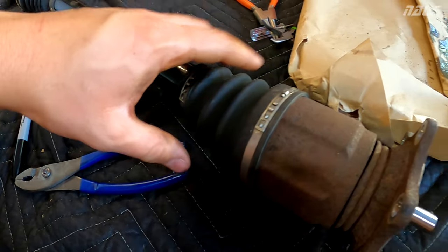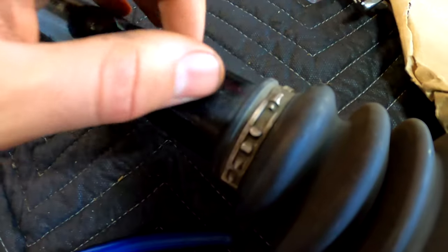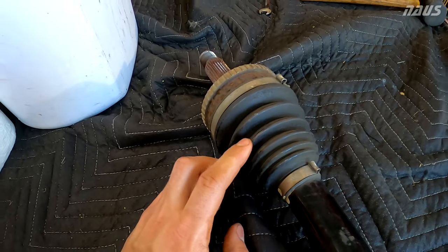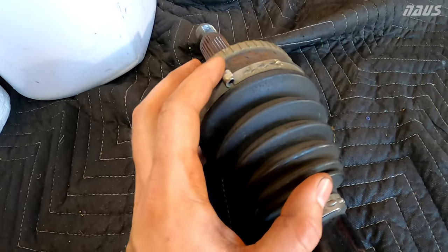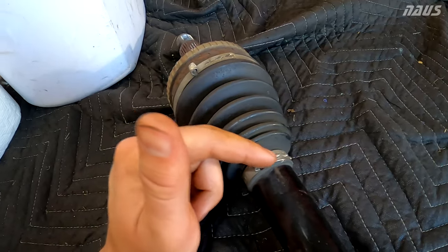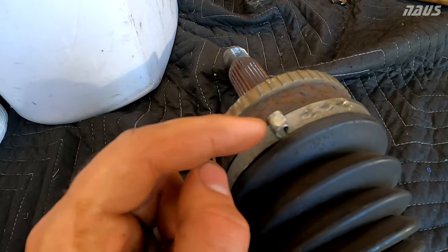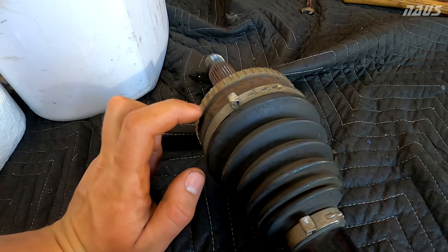The nice part is these inner CVs have this hook-style clamp on both ends, so I took both off the same way — up here you use these two lips with the pliers, and back here you use these two. So you can reuse these clamps on the inner CV side that usually needs the maintenance. The outer CVs, which take the thicker grease, have pinch clamps — much trickier to reuse. There's a special pinch clamp tool to get the proper preload, and the only way to get it off is to loosen the bend to get it off the hook. They're not going to be as ideal as the first time they're crimped.